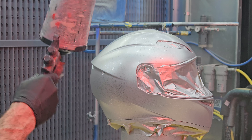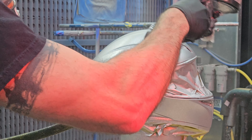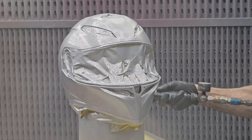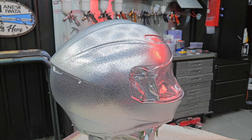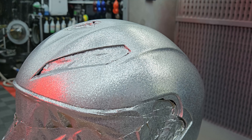Now I'm ready to paint it. I'm using a 1.8mm spray gun, and I'm going to just keep spraying coats, waiting 5 minutes between coats, until I've got the coverage that I want. I want this flake to be fully covered so you can barely see the silver. I want it nice and chunky and full so that it looks mad when I do my lines.